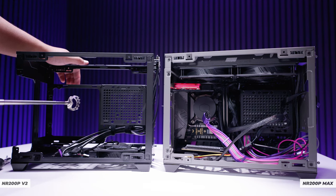It doesn't touch, but it can be a bit of an issue when your fans get to a certain RPM, because with the centrifugal force and the way that the air is pushed through the radiator, the hub of the fan begins to push away from the frame, and half a millimeter is enough for it to make a rubbing sound. I did find a little fix, and that was loosening the side case screw a little bit and the top case screw on that corner. That gave it less than half a millimeter of adjustability. So that fixed it for me.